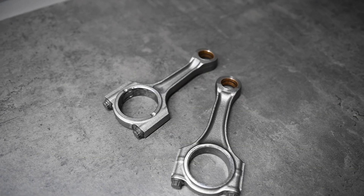Even if the rod looked straight, increased torque and detonation or pre-ignition often compressed and permanently shortened the rod, leaving you with reduced power and a ticking time bomb in your engine.